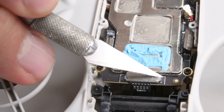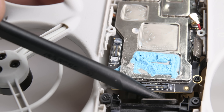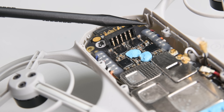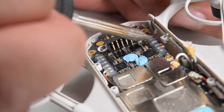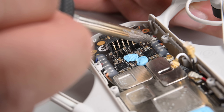Moving to the front of the board, I can remove the press connector leading to the 12 megapixel camera. It is possible to remove the camera gimbal without removing the mainboard, but since I'm taking the whole thing apart anyway, I'm going to remove the glue and desolder the wires leading up to the motors first. I'll use my iFixit smart soldering iron to melt the glue out of the way so I don't risk scratching the mainboard.